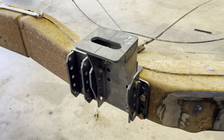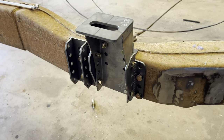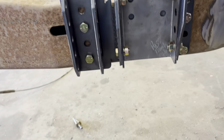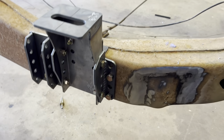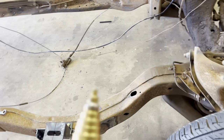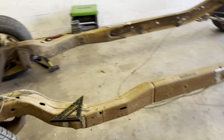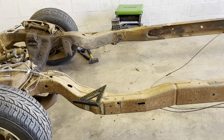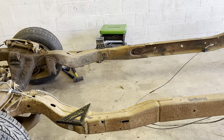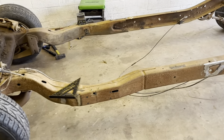It'd take a pretty big collision to rip it off the body, but I don't plan on wrecking this thing. So let's see the four bolts we're using. I've got to go out and drill the other side out a little bit - I'm just going to use this little drill bit. This is about perfect size once I get these holes wallowed out. We're going to bolt the passenger side cab mount on and we'll take our measurements and get the back ones put on. Stick with me guys and we'll get to it.